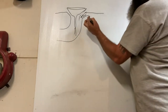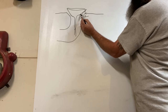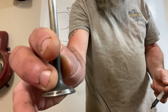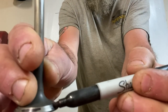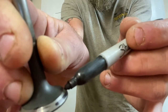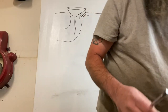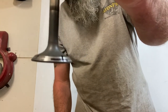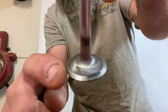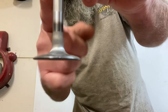On the valve itself we're going to want to do what they call a back cut. We're going to knock that edge off — your seat contact is right here, but you've got all this part of the valve in the way as it's opening. We're going to make a back cut right here. If it's a 45-degree valve like all exhaust valves are to my knowledge, you'd want to make a 30-degree back cut. Back cut it up until you reach your contact point. You can take all of this out up to that contact point or very close to it. You can actually see on this exhaust valve — that's 45 degrees — and this is a 30-degree intake valve. You can see a little shine and then a dull area — that's actually a back cut. We're making a nice smooth path for the airflow.